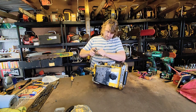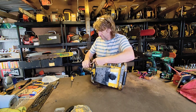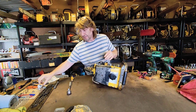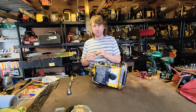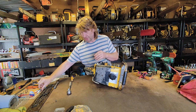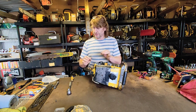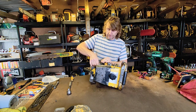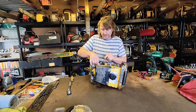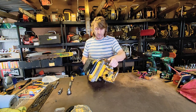Older style plug. Another essential piece of equipment to have, and just certain things, don't skimp. Okay, one brand new plug all the time. Just keep one plug. You don't run it, test it initially, know that it's perfect, and then just keep it as test equipment, so that for certain engines you always are going to have a plug. You don't have to think, oh, is that one okay, or is that plug right.